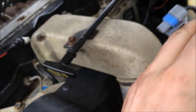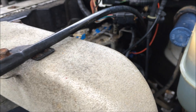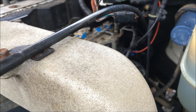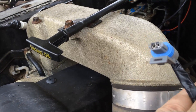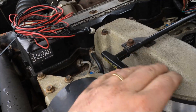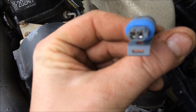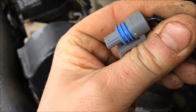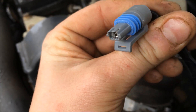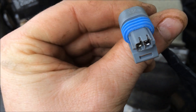It's a gray plug. I just unplugged that one — you can't really see it, but it goes right into the side of the block. It's kind of a pain to get to. So you just unplug that switch, splice this in between, and I'm going to run it up through the firewall right there. The coolant temperature — I'll just run it here and then probably run it up the dipstick. These plugs are kind of a pain to figure out with these pins. When you go to insert the pins, you have to push the wire in through the switch, connect the pin, and pull it back.